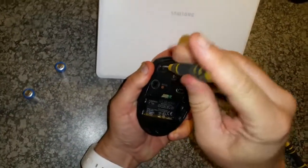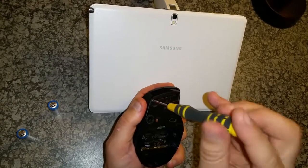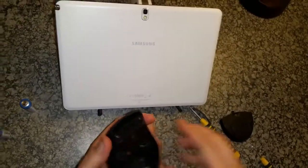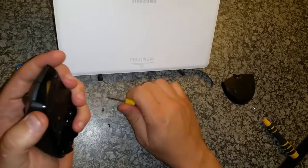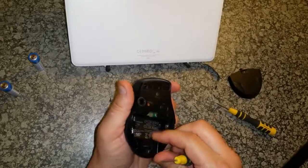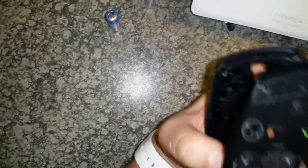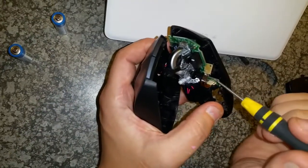Take the top screws out. The problem is the laser assembly becoming dislodged. I'm not sure why it should even be able to be dislodged, but that's what happened. I'm on carpet so I can't imagine too much of a shock taking place, but apparently something happened. Here's your laser assembly — looking at it from this angle I figured it might be meant to be diagonal, like some sort of mirror, but no, it's meant to be flat down, not sticking up like that.